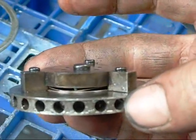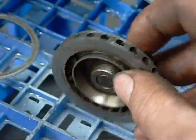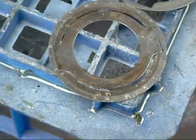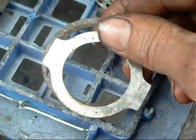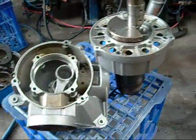Now it's just a close-up of one of the valve assemblies. You can see there's a leaf spring in there all the way around, and another disc which is the discharge valve. And that's the inlet valve assembly. And that's the main head gasket — aluminum washer.